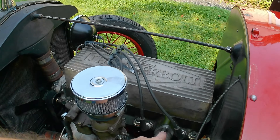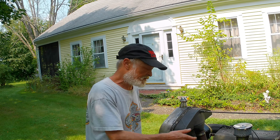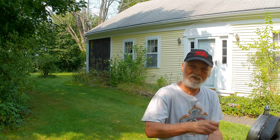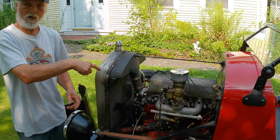Did you get these bolts from Neil? Yes — the exact same bolts that came with the kit, same as the head bolts. I told him to send me a box with absolutely everything I need so I can just bolt it on — push rods, the whole thing. I just opened the box and put it on. He milled everything; Hans cut out all the babbitts, line-bored everything and said it was right on the money.